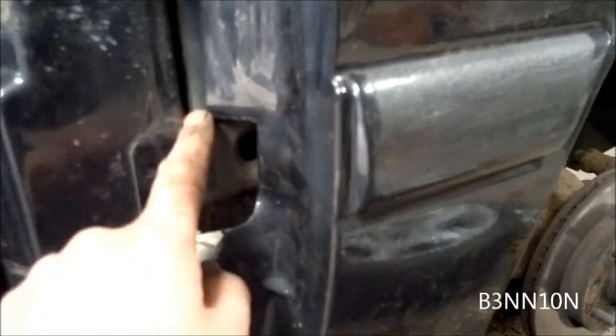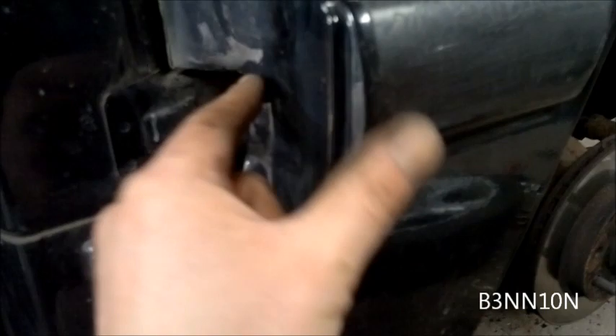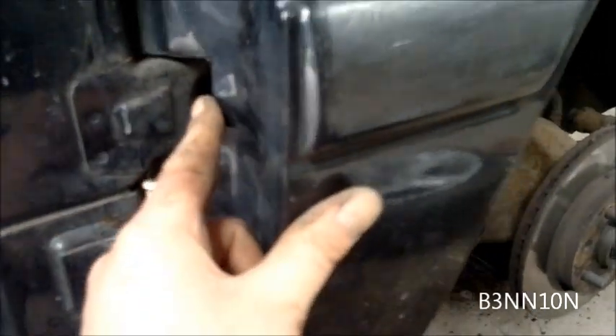What I've done is cut straight along there and folded the metal back. It's still got the paint on it so it's probably better for rust purposes. The bottom won't be a million miles away when I bend it. I'm going to make a little incision there, and there, and bend this round - it'll give the wing something to hold on to the sill with. I'll probably stick a screw through the back; I'm not going to weld it.